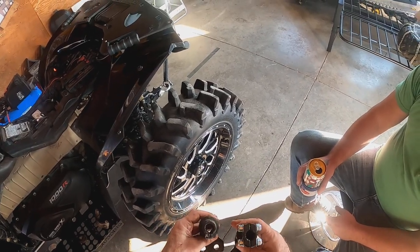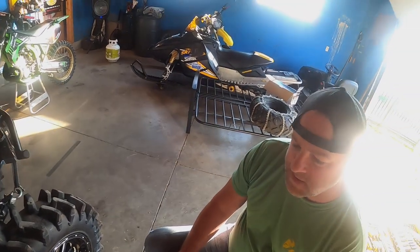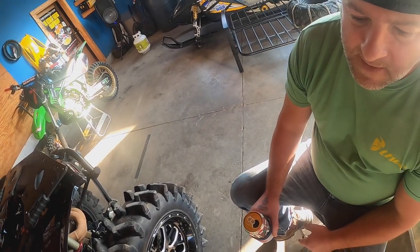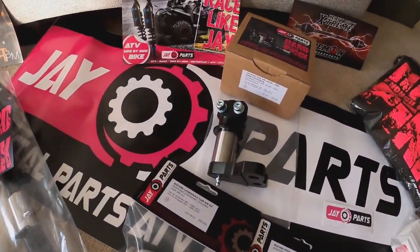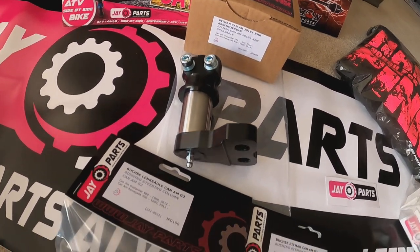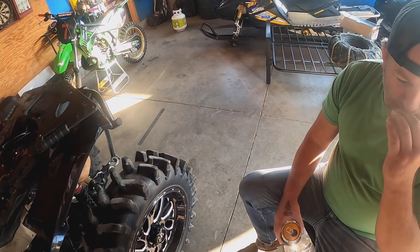So this one, singular relief, not very wide. Quite a bit wider right out of the gate, right? Yeah. Spline, pretty shallow, right? Pretty aggressive in the depth of the grip here, the cuts and the teeth. Twice as much. So double pinching action, much more aggressive grip, greasable.